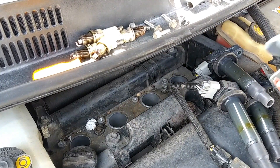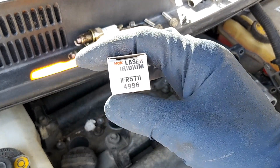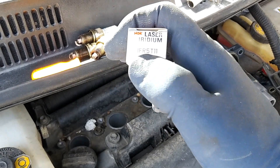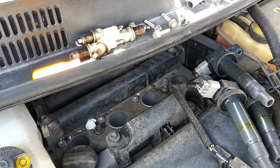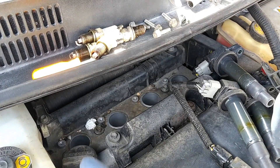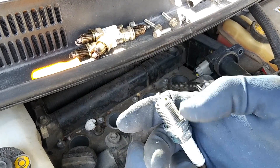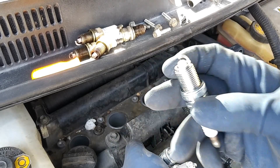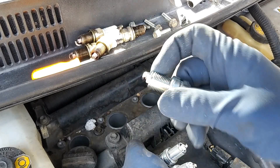Now we're going to go ahead and drop in our new spark plugs. Here's the spark plug part number — it's going to be the 4996, or the other part number would be right on the spark plug itself. Again, it's better to keep these original equipment as NGK. Do not put any other plugs besides the original equipment. Also, you don't need to pre-gap these — they are already pre-gapped to the manufacturer setting. They should come with a little cardboard box or plastic coating around them just to keep the tip from getting damaged.